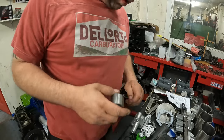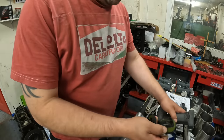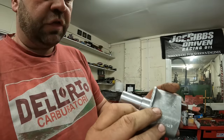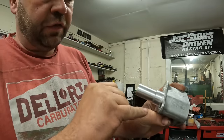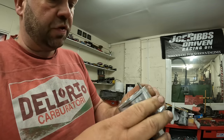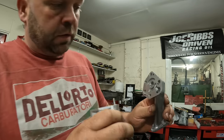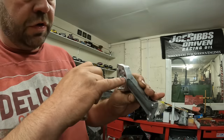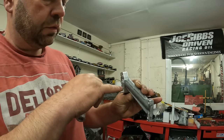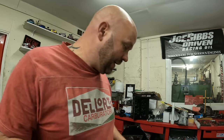So the next part of the oil pump is for me to assemble it now. Now it's all been through the cleaner, just to make sure that there's no more obstructions in there. Make sure it's all nice and clean. So that's the body of the pump. Also the top of the pump, because I've drilled down here, I want to make sure that there's no swarf down there that can get in the way. It's all been blown through anyway.